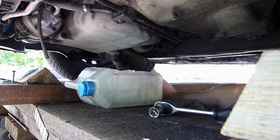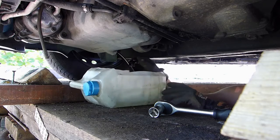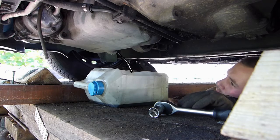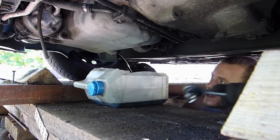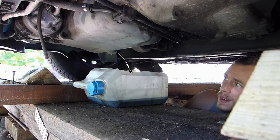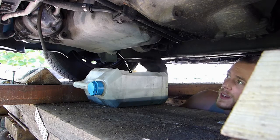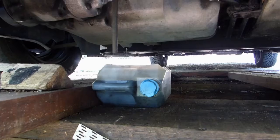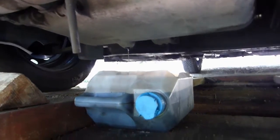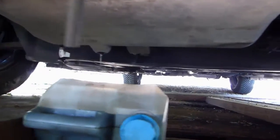Make sure you get the old washer off as well, and avoid dropping the screw in. Okay. I think I haven't got the washer, it probably fell in, so just make sure before putting the new sump plug in that the old washer is not still stuck against it. Alright, so we're just going to let all the old oil drip out.